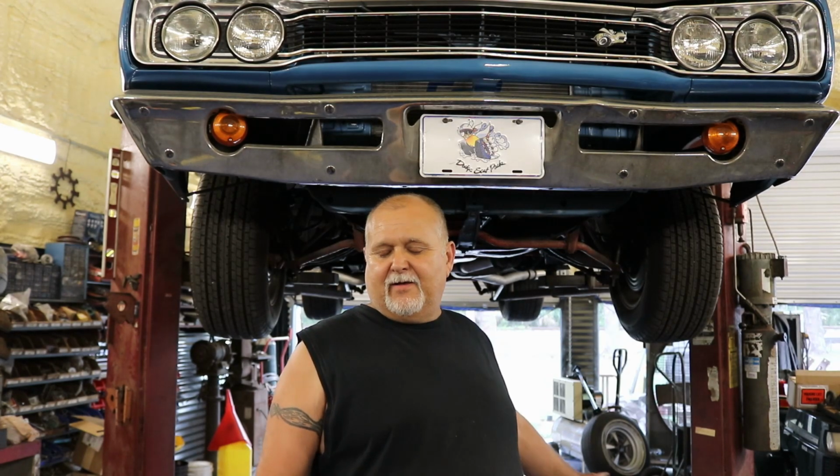So I've got the nitrous pretty much complete. It's all wired up. I haven't tested it or anything other than I did test my purge valve. So before I do anything on testing, I still got to set my EFI or my fast box into the handheld. I got to go through and tell it that it's got nitrous now.